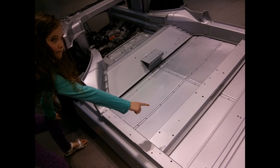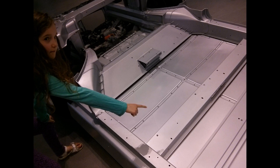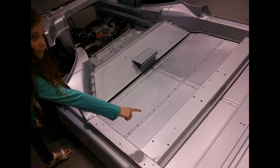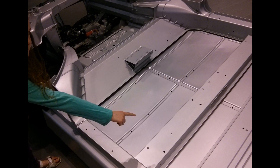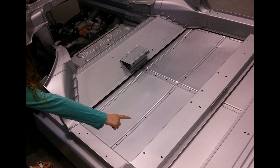And here's the battery. The battery is four inches thick, and it's filled with 7,000 small cells. It's wide and flat and covers the entire bottom of the frame between the four wheels. The battery and inverter are liquid cooled with a reservoir and pump.